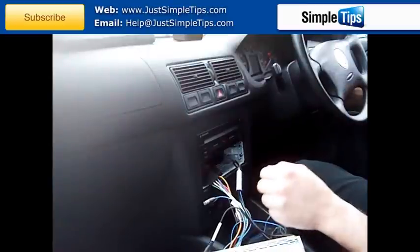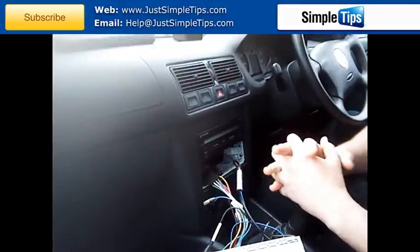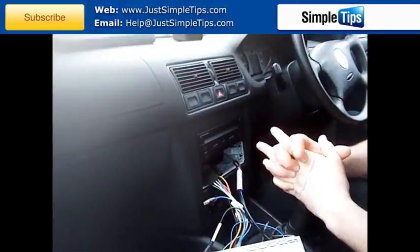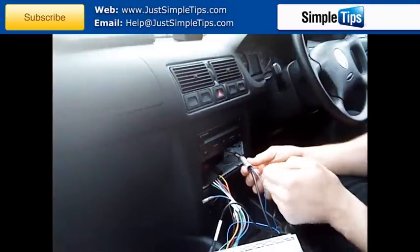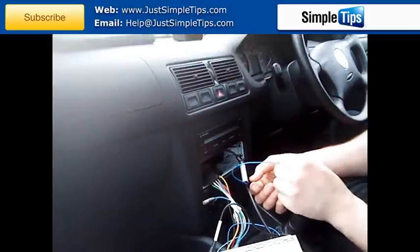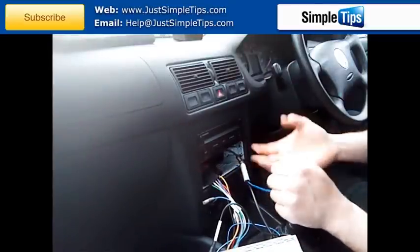That now shows you that we need that part for this vehicle. A lot of people do not realise this and think they have a bad aerial, as the unamplified signal sounds like a very bad aerial — but it's just that the amplifier is not turned on, so the signal can't work its way through the amp. Do this simple test with a PC552 or PC5136 and you'll know if you definitely need it or not. If there's no improvement, it's not needed. If there is improvement, it's clearly needed.